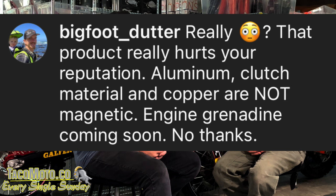They chose that name intentionally because through their testing and evaluation, it's the ultimate oil filter you can put on your bike. What the product essentially does is eliminate your paper filter and replace it with magnets — so instead of a pleated mesh filter, whether paper or stainless steel, you now have a magnetic rod that attracts the particles.